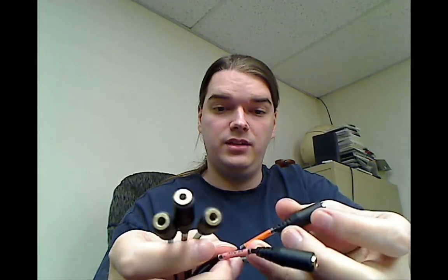Oh, this is the analog breakout cable. A custom jobber for the Auzentech. You can see right here, it looks like a monitor VGA cable, but on the bottom it has line in, rear, front, mic in, center, left, right, or center LFE, which is your subwoofer, and side. So 7.1, a line in, and a microphone.